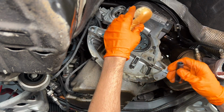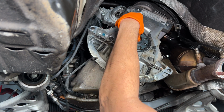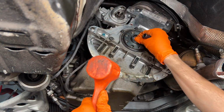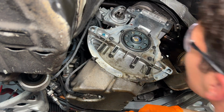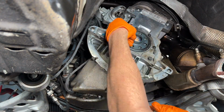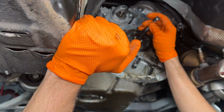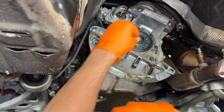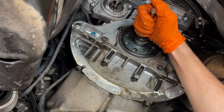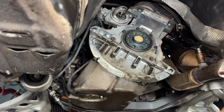That's right, boys. We're going the old school method. We're going to be punching this bread into that hole there in the pilot bearing and just using good old hydraulic pressure to get this bearing out. So let's get on it. There we go. Now that bread that's getting pushed out the back is gonna be stuck, and that's what's gonna keep creating more pressure in there. Might need a whole nother hot dog bun. Can you imagine? Let's go. Method worked. 10 mil socket and a bunch of freaking bread. It's coming out in one piece.